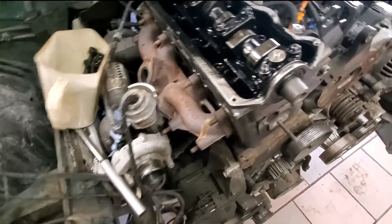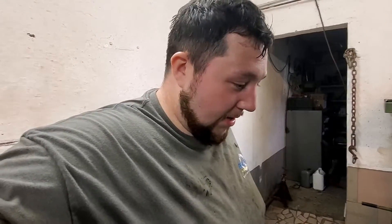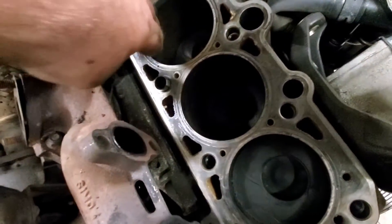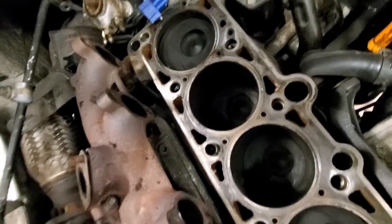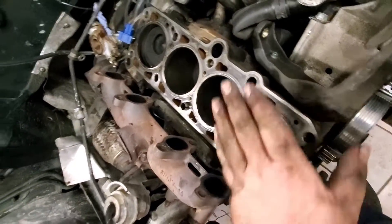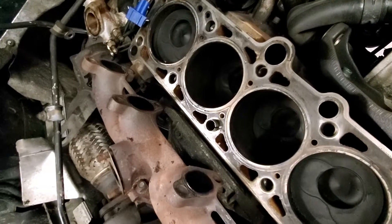So I got the head off. I'm in the middle of the work right now. We got the cylinder head off — take a look at the cylinders. The cylinders are really fine; you can still see the crosshatch in the cylinders and it has over 400,000 kilometers and it's in pretty good condition. The head is already at the machine shop getting resurfaced, and they're doing a pressure test on the water system.